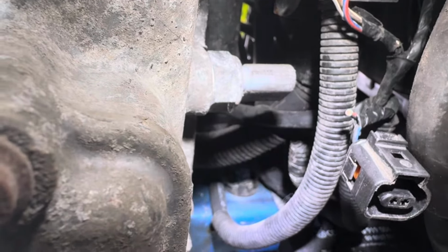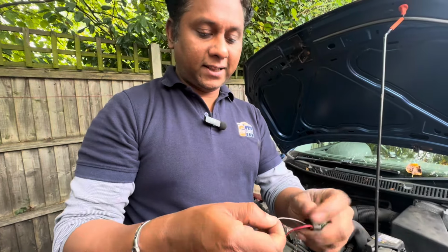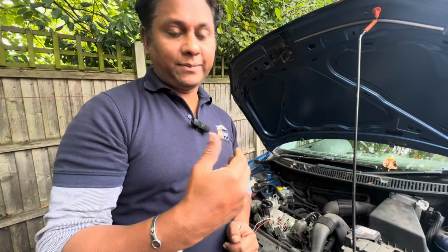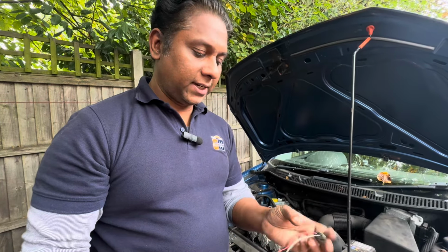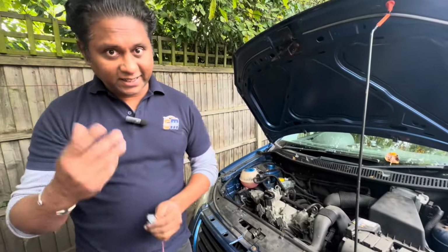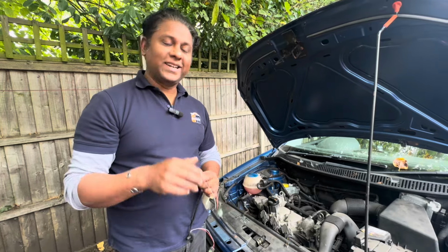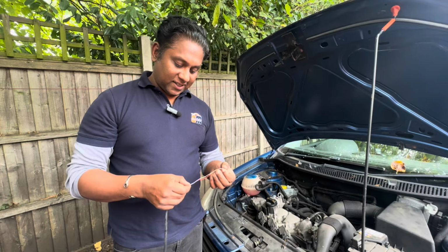Now we know the problem. You all saw one wire there and one wire broken here. However, for VWs in the UK you can ask for the connector and the wiring. Then I'm going to order the new wiring, connector and wires, and I'm going to do a DIY job, cut here and make the connection here. Once I get the part, I'll come back to you. Now if your reverse light is not working, you know what to do, you know how to check. Yeah, see you soon.